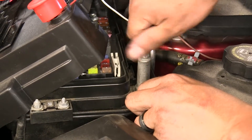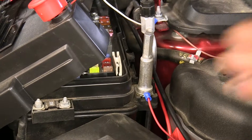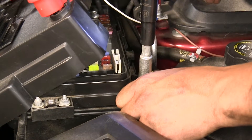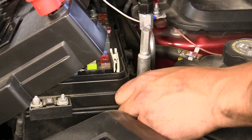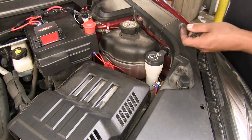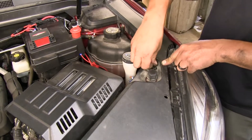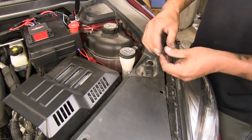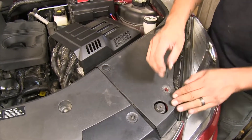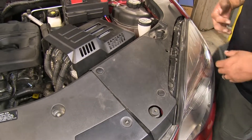Make sure you put any kind of wires back that may have come off. We'll tighten it up and then we can put our fuse box back in place. With our wire and breaker in place, we're going to put all of our push pins back in. Also double check the routing of your wire to make sure it's not going to rub on anything or come in contact with anything that may cause damage to it. Once everything's good, we can go down below and wire up the plug.